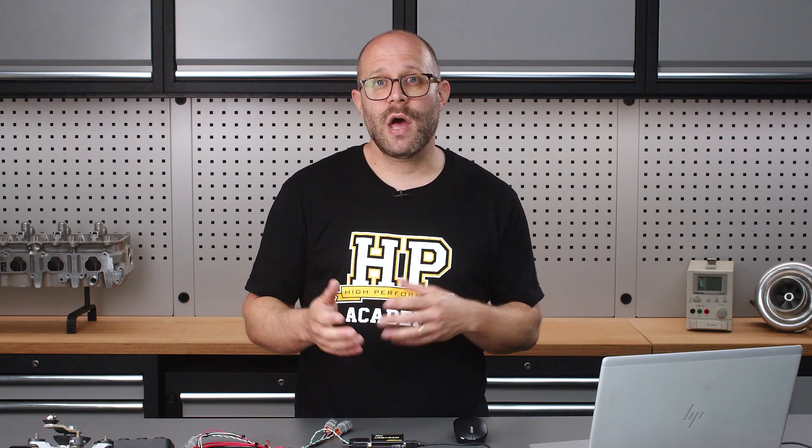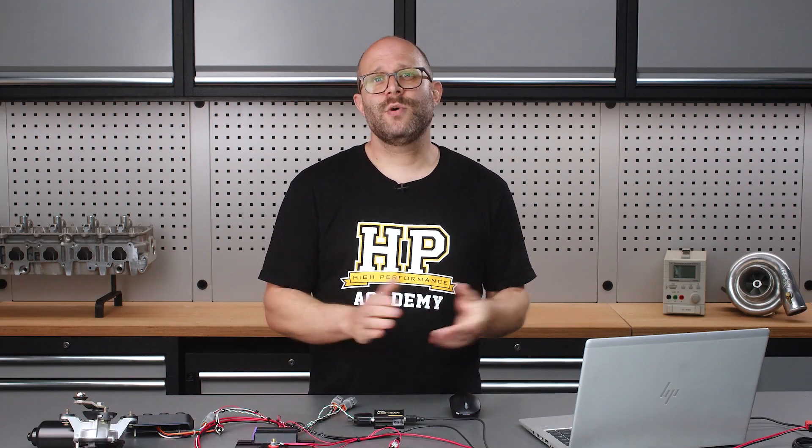This means we're going to need a control pad of some form, and the majority of PMU manufacturers have tried to make this as easy as possible. There are a couple of common keypad series on the market: the 3K G1 series by Greyhill and the PowerKey Pro series by Blink Marine, which PMU manufacturers have chosen to support. Both keypads communicate to the PMU via CAN on the J1939 or CAN Open protocols. These keypads were initially developed for the heavy industrial and marine markets, meaning they have excellent ingress protection ratings and are very robust.